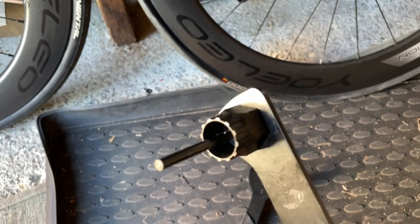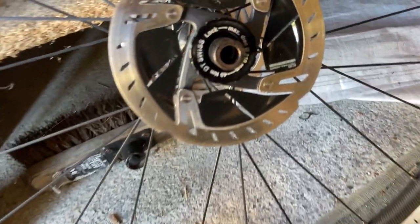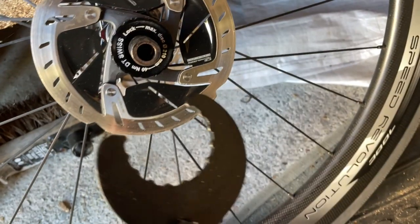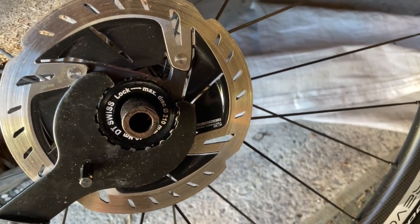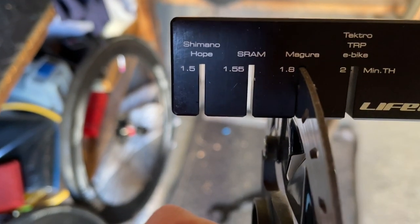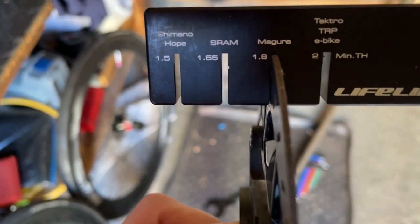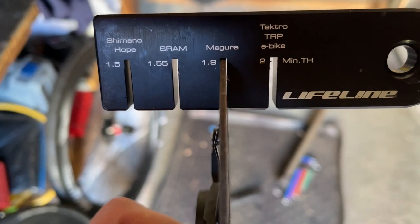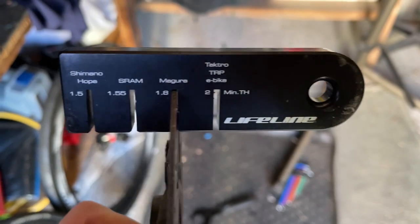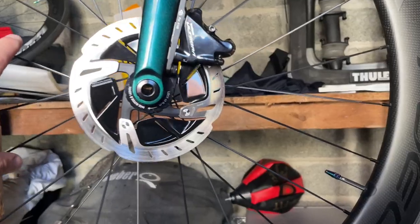Most of you I'm assuming will have a center lock ring attachment for your rotor locks but I don't. I'm going to be using this tool and mine fits on the outside here. Just checking the 140mm rotor for thickness — Shimano minimum thickness is 1.5mm. I can't get the 1.5mm on the rotor but I can get the 1.8mm, so I'm well within tolerance. Good little tool to have so you know when your rotors are too thin. Okay so we've now got our 140mm rotor on — let's give it a spin.